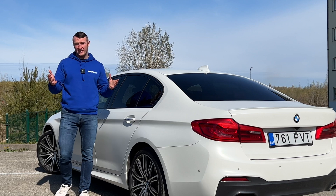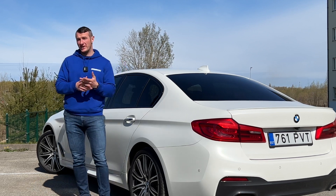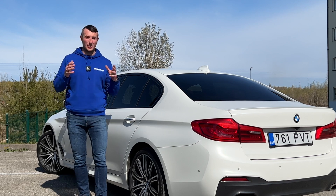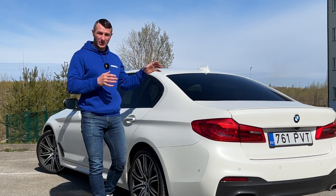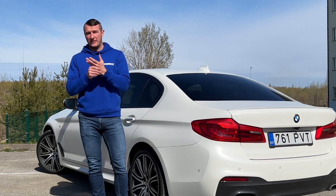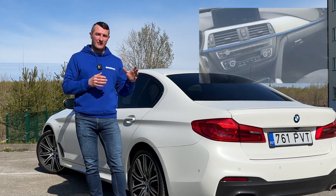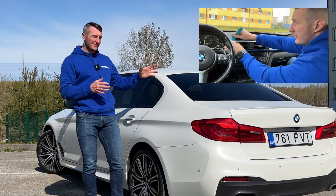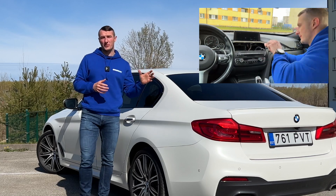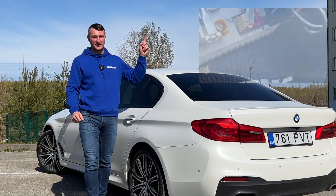You might wonder, why do you need a Wi-Fi antenna at all? It is needed for Apple CarPlay and Android Screen Mirroring or Android Auto to work properly. Without a Wi-Fi antenna, your head unit cannot connect properly to your phone — you will have connection disrupted, very unstable, or cannot connect at all. I have covered all those details on how to see if you have a Wi-Fi antenna present in your car without even disassembling anything in my previous videos. Make sure you have seen that.